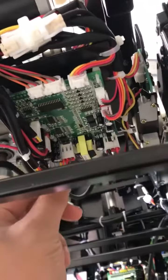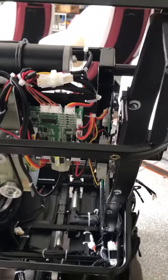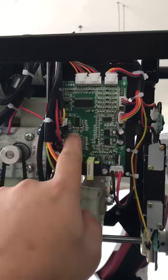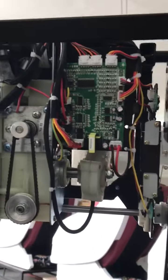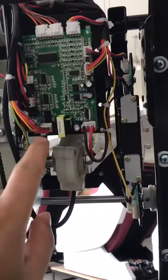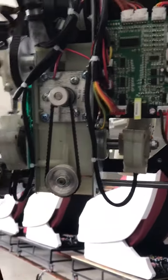The problem is mostly about this cable, this board, or the connector from the cable into the board — that might have a problem. Firstly, connect the power source and turn on the chair, and see if you can see an indicator light on the board. It's basically here. If it's lighting on, then the cable is clear — the problem is about this board, so replace this board.